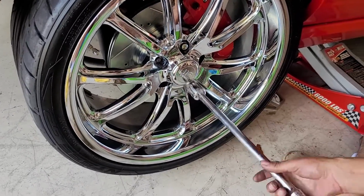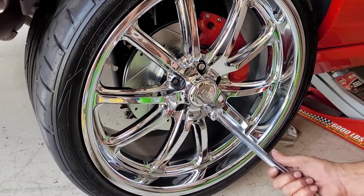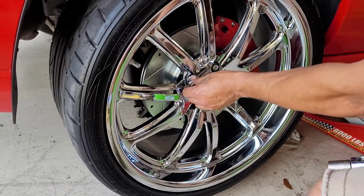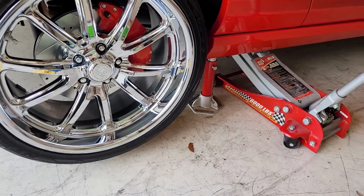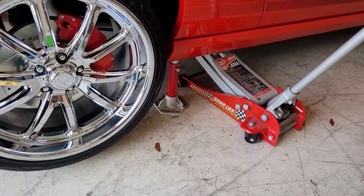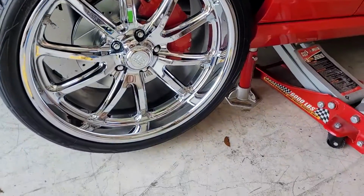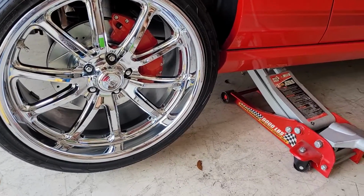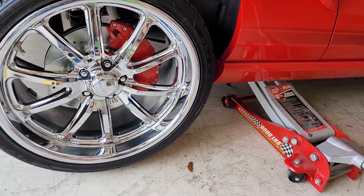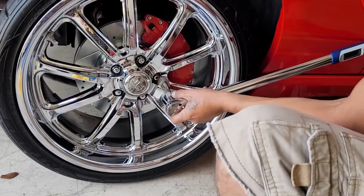Yeah. The specs, he's gonna use his electric torque tool, and it should be to 100 pounds on all tires. Just for safety for the rear, he did keep the jack and the jack stand, and he put the little blocks in the front of the car just so it doesn't roll forward. This is all for safety reasons. Again, when you're in your car, the last thing you need is something falling. All right, bring the car down slowly. It will beep when it's to spec.